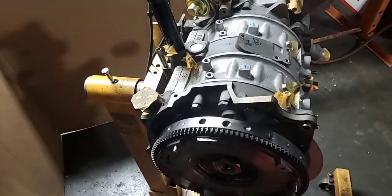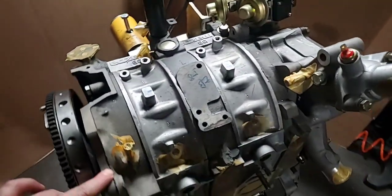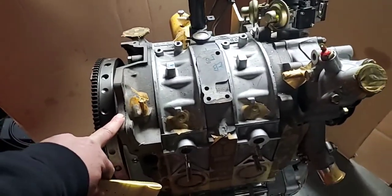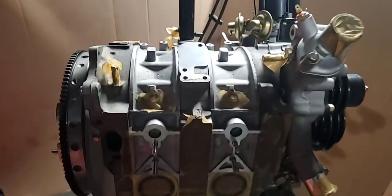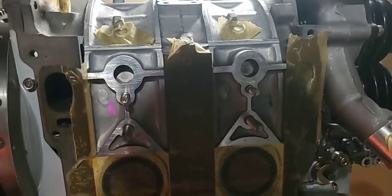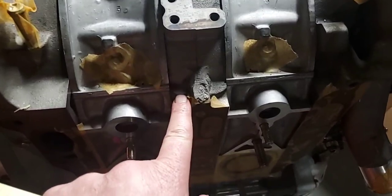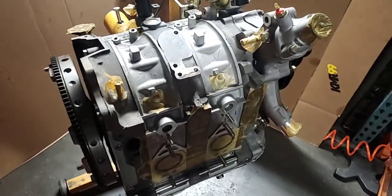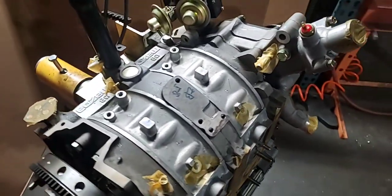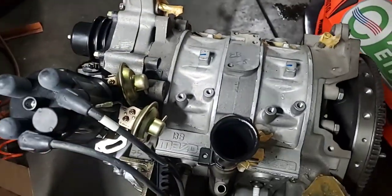It has T2, or 1989 to '91, turbo side housings, so you've got the four-port configuration. There's tape on there but it is a four-port intake. It does not have primary injector holes from the factory, so they must have had some other method for injecting — especially since it was obviously a propane motor. It's also unique in that it has turbo two sides, or late-model sides.